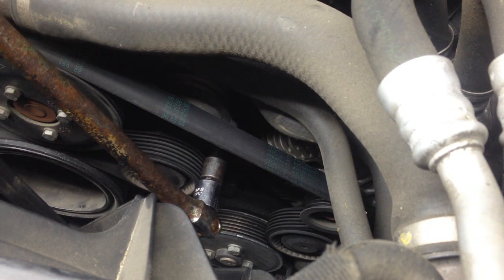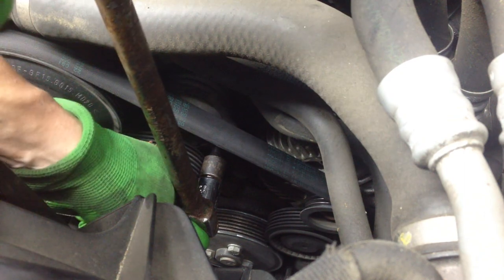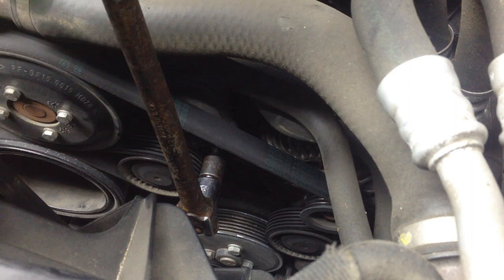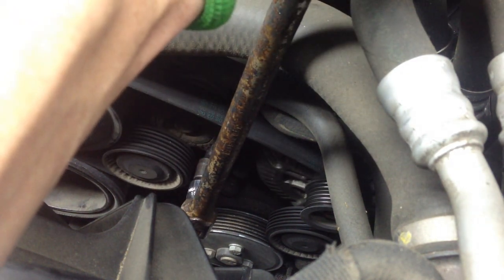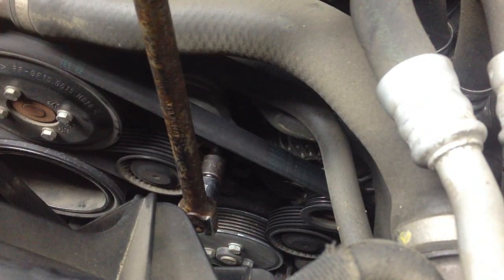I have my T55 inserted into the slot and I'll try to get the best shot I can — it's kind of hard without a camera man. It's right below the belt where I insert the star, and you're actually going to be pulling it righty-tighty, so you pull your breaker bar — and it's a lot easier with a breaker bar, guys. Just make sure it doesn't slip out; you don't want to snap your belt. Crank it over to the right and see how the pulley is loosening. Once it's loosened, you can go ahead and take it on and off.